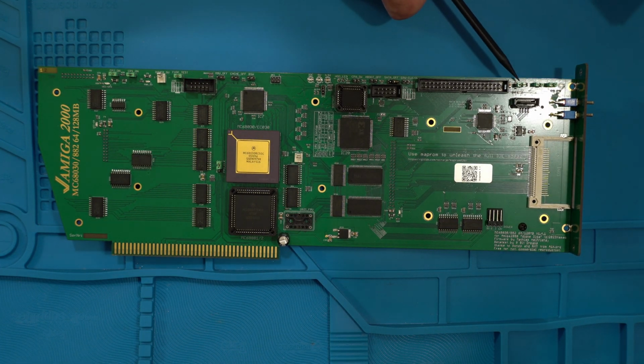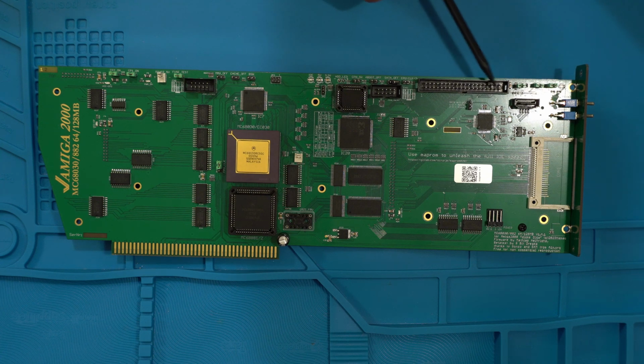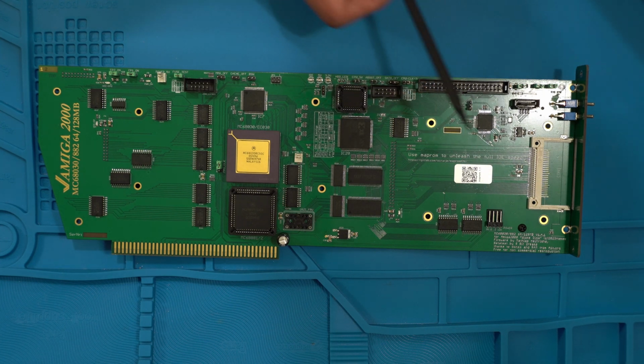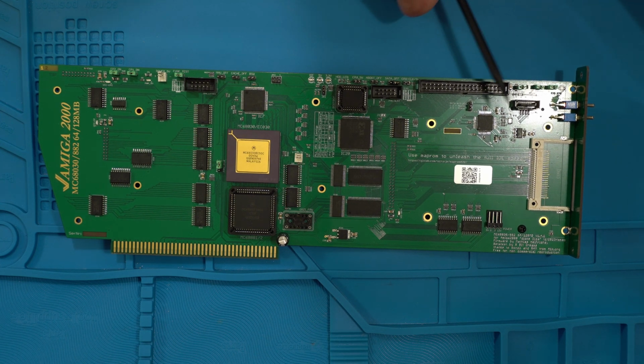And then you have some more jumpers over here, which is your key power. So if you have a disc-on module, or a compact flash card you don't want to wire an external power source to, it can get powered through this interface right here. Be careful, some devices might cause issues, so just take that with a grain of salt. But to be on the safe side, I would just power it from the power supply, or like this one uses a floppy type connector. I do have compact flash adapters that plug in here that you can power with a floppy type connector, but it's up to you. Just be careful, because there may be issues depending on the device you're using. So I would just try to go with external power. So that to me is turned off.